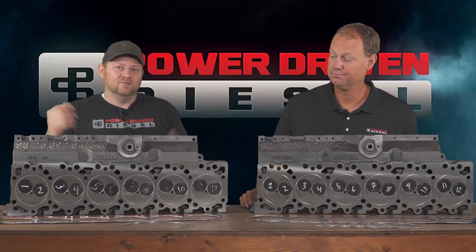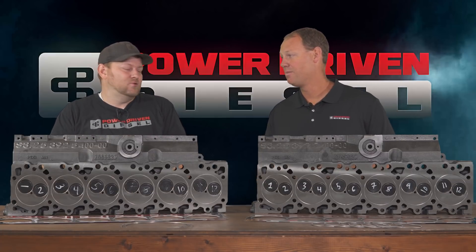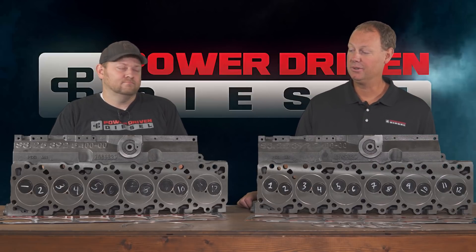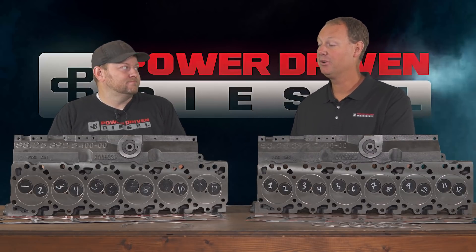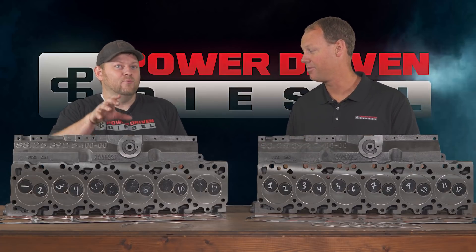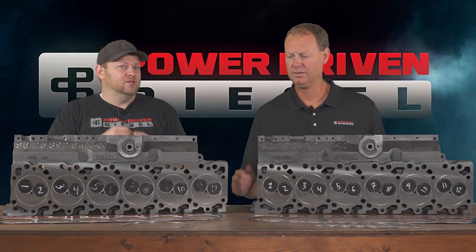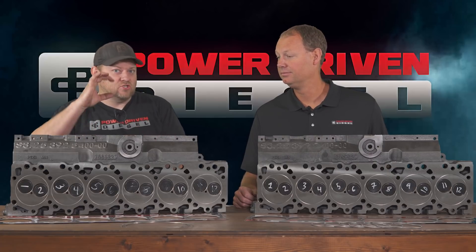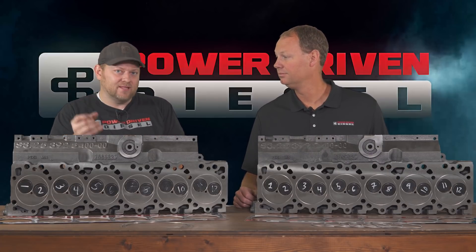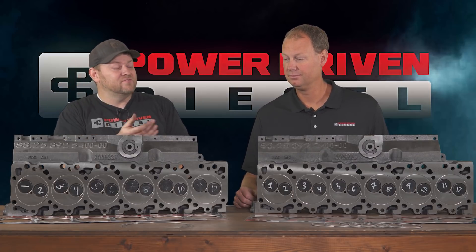O-rings are very common in gas performance, diesel, motorcycles — anything, for a long time. It's kind of old school, but it works really, really well. It's been popular for a long time. And before we move away from o-rings, even in a stock application there's no drawback — you don't need special fasteners. The wire is so small pressed in there that there's enough clamp load with factory head bolts or head studs. It's just fine.